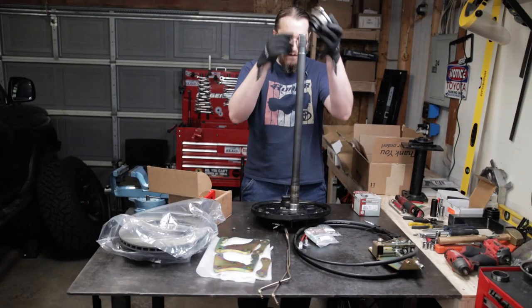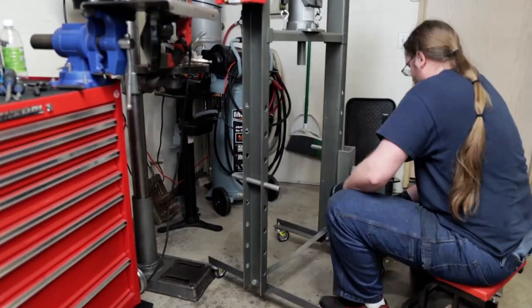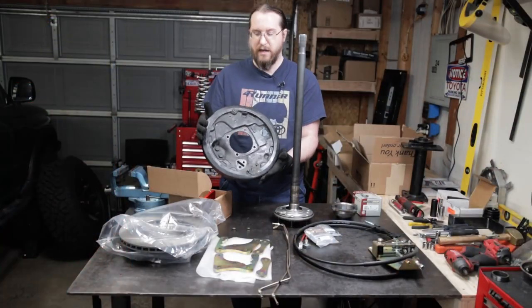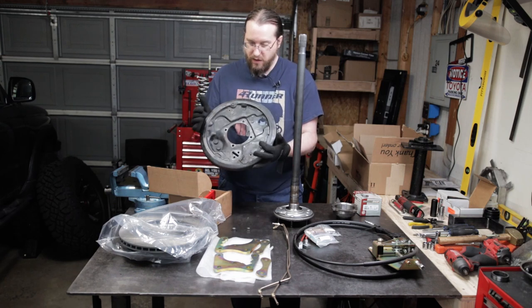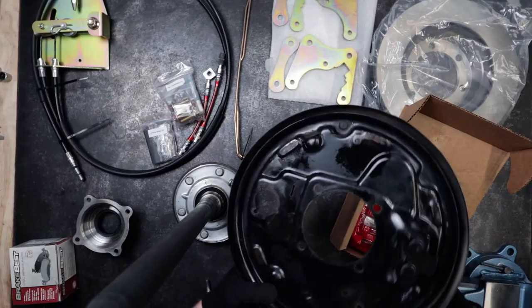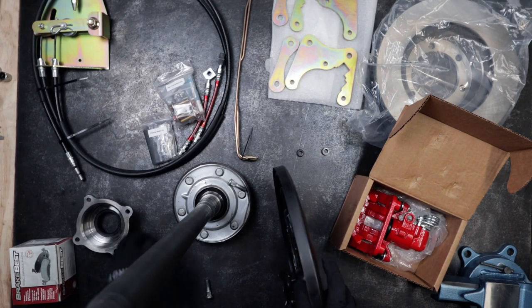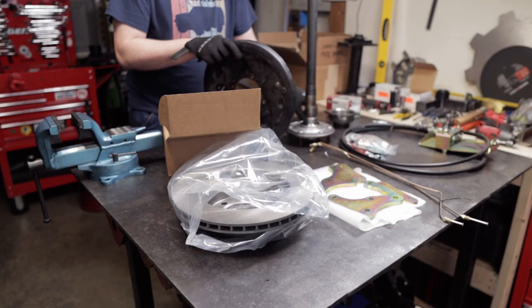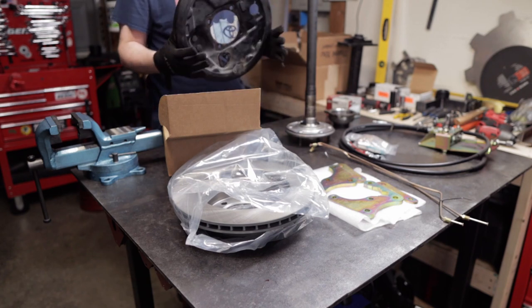What I've chosen to do is completely press everything out. That way my backing plate stays intact and I don't have to worry about it, because these backing plates are hard to get and expensive. Mine's not rusty, so if I ever decided to go back to rear drum brakes I could essentially just slap everything back on — with the exception of the parking brakes, because when you do the parking brake conversion you'll have to snip your parking brake cable. So those are the two options: pressing everything out or slicing your backing plate open.